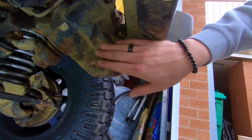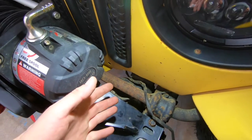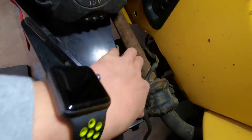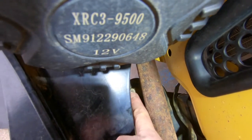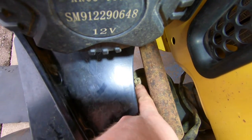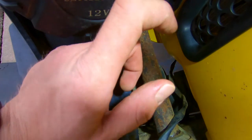Mine are solid on this end. If anything, I have a little bit of slop in my gearbox — inside the steering box. How do you address that? There are two ways: one is to obviously replace the steering box, and the second is there is an adjustment nut right here. You loosen that lock nut and turn the screw inside with a screwdriver — don't turn it much, maybe an eighth to a quarter of a turn — then check the slop in the steering box, because that basically tightens up all the gears inside.